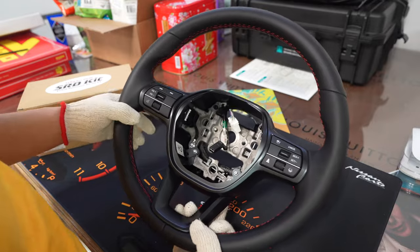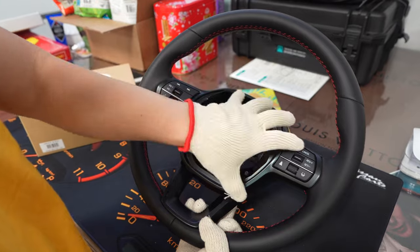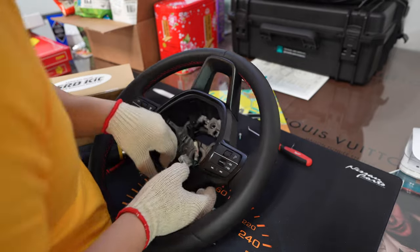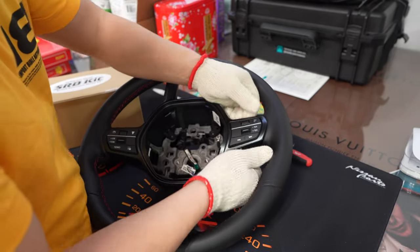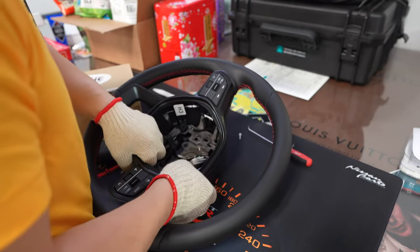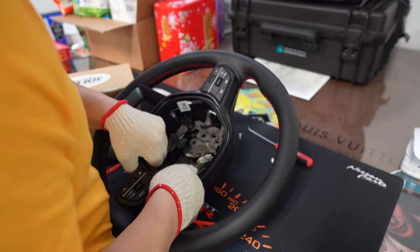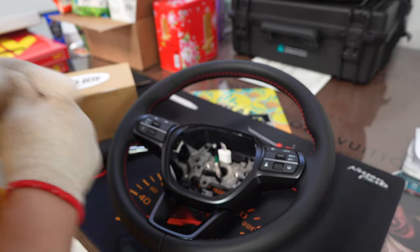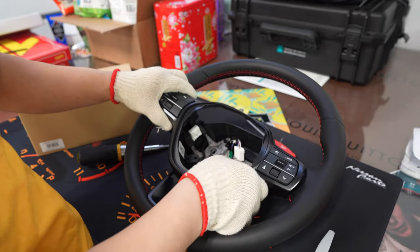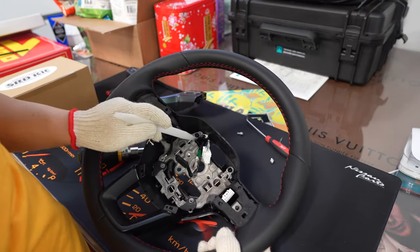What we're going to do is remove the Phillips screws — one here, one here — and the ground wire, and that will enable us to remove the front fascia. Now we should be able to start popping them off — just work your way around. Then go ahead and unplug your audio, and on this side it should come right out. To get to the wire harness I need to get the back cover off, which is held on by these tabs.